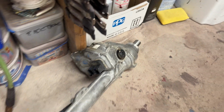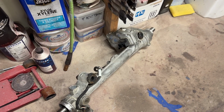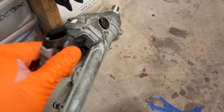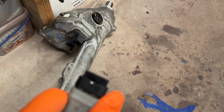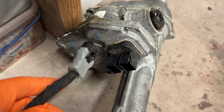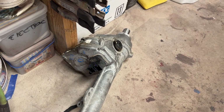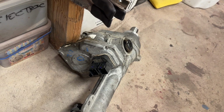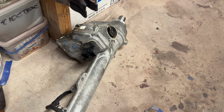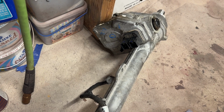Because if you look at some other vehicles, especially the Mazdas, they have what's called a torque interceptor, which basically you would take this from your steering wheel and plug it into the torque interceptor, and then plug the torque interceptor into here in the Mazda equivalent of this layout, and it would be able to tell the power steering control module there that the driver was turning the wheel, even if the driver wasn't, even if it was your openpilot. And the question becomes, why would you want to do that?